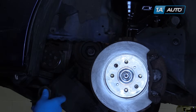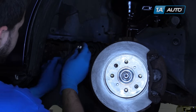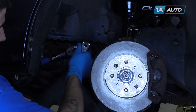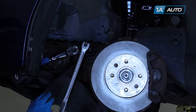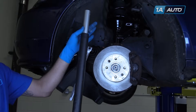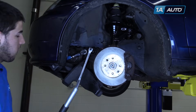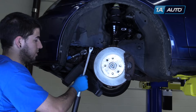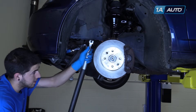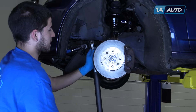You'll need the special holding tool from Honda, which sits into this hex, and a strap wrench to keep the pulley from turning. Use an extension and a breaker bar to get onto the 19mm bolt in the center of the pulley. These tend to have a lot of torque on them — they're very stubborn. So we're going to use a cheater pipe on our breaker bar; this is actually the handle off of our jack. It takes a good bit of force to break these loose.